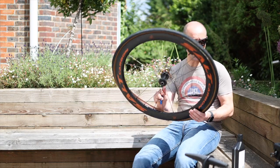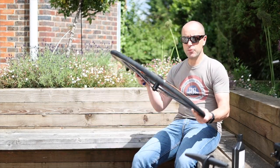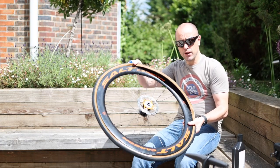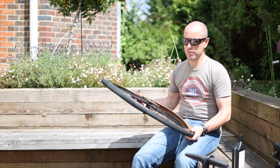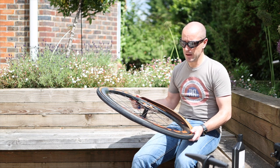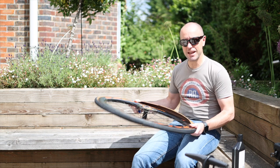Let's give this a go. I've got two tyres, both with new rim tape fitted. I've taken the valves out. The process is: put the tyres on, leave a gap, put some sealant in, close it off, blow it up, hope it seats, and then slowly take it off and put the valve core back in. So let's see how this pump does.